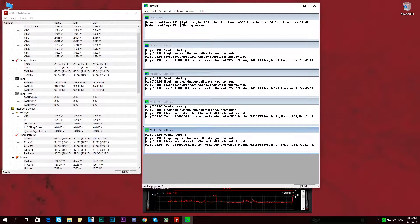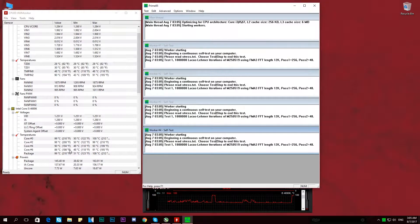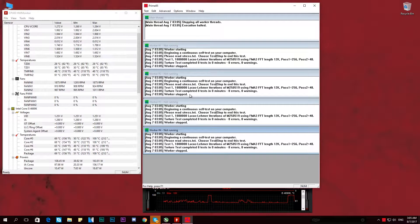Basically my CPU was overheating — as you can see on the screen it's over 100 degrees. I don't know why, because my CPU heatsink and fan weren't that dusty to justify going over 100. So I took the heatsink and fan out, cleaned the fan, reapplied thermal paste, and put everything back on the motherboard.